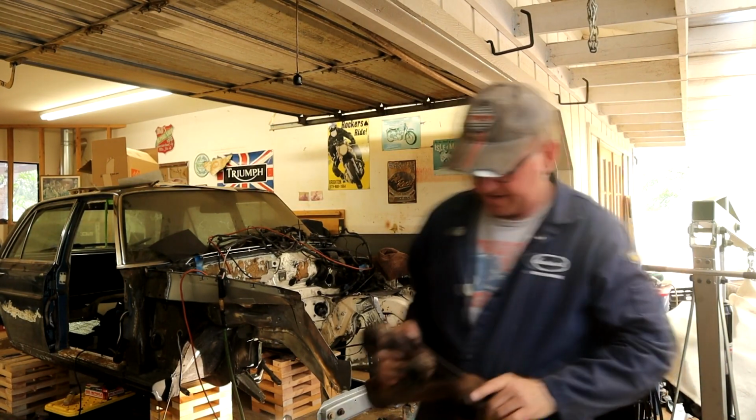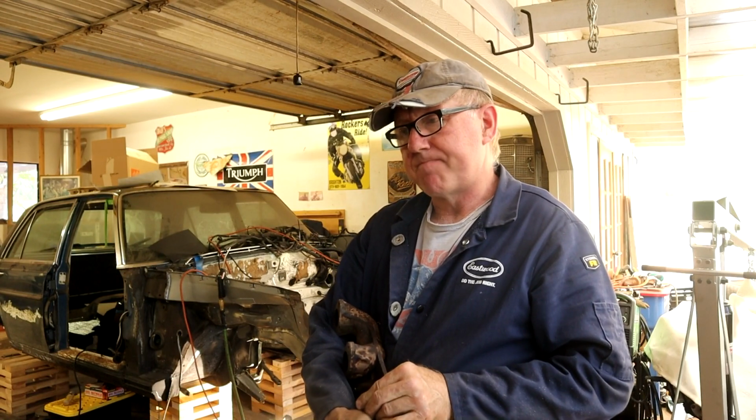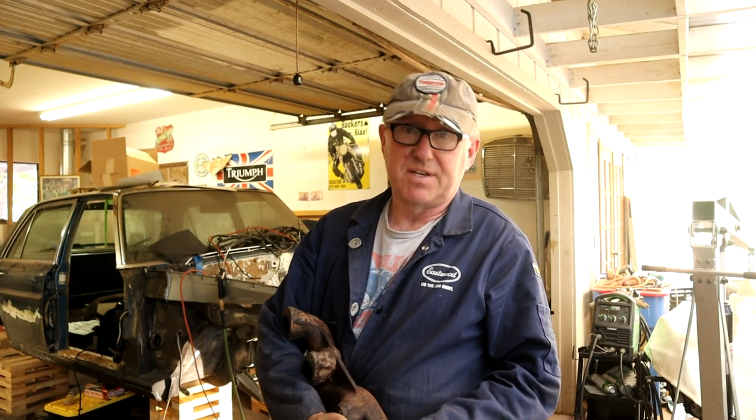Okay. One other thing before I go, I removed the exhaust manifolds on the 6.3. I did unfortunately have a couple of broken studs, which I'm going to deal with later, and they broke below the surface, which is a bit of a drag. I may try the welding method to pull them out, but I'm going to see about that. First things first is to get a compression test on the motor, and that'll give me an indication of condition and everything. Adjust all the valves, make sure I can see what the compressions are like, and then go from there. If I have to pull the heads, I have to pull the heads. I probably will anyway, just because, you know, it's been a long time under there, and probably could do with some new head gaskets anyway. I know they're not cheap, but while I'm in there, you might as well do what you can. And in that case, I'll remove the cylinder heads, take it to a machine shop, have them remove those studs, and get some new exhaust manifold studs from Classic Center.